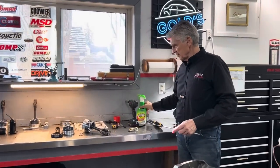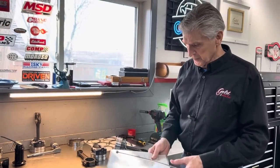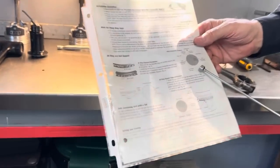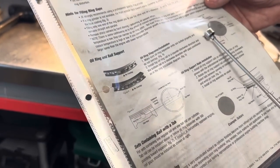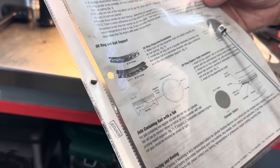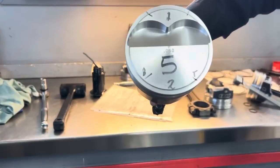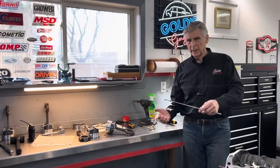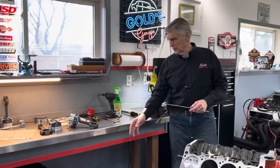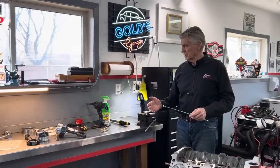While we're assembling, I'm going to point out a couple of things I do to stay organized. When you buy your pistons and rings, the instructions show you the orientation of where everything goes. So — this is the front of the engine — the top compression ring goes on this side, the second pressure ring goes there, the expander rail goes here, and the two oil rails go here and here. I usually mark out a piston in advance and put all those positions on it. When assembling an engine, do all pistons at the same time for a given operation — you don't have to hunt for tools and parts, and you take advantage of repeatability.